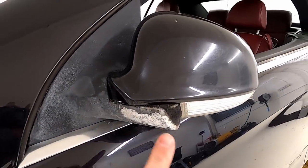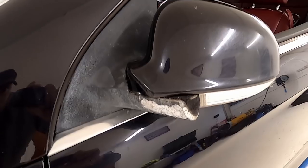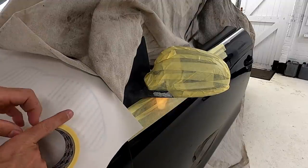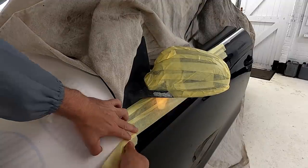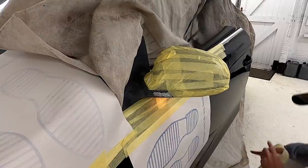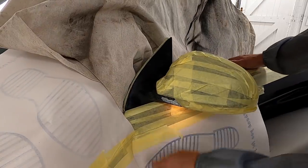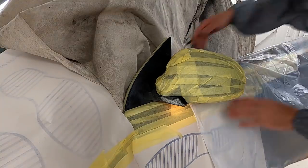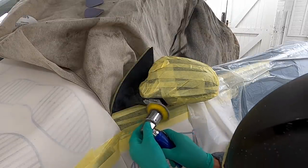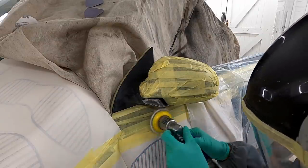Another thing letting the car down was these mirror surrounds - as we can see they get a little bit of light corrosion in them and the paint flakes off. This was a problem for the earlier Eos, I think up to about 2009, and then Volkswagen changed to a different type of mirror surround so they didn't have this problem. I've thrown a big dust sheet over the top of the car and I'm using some floor mats to mask up the area local to it, plus a seat cover over the door. Most of the area has to be done by hand but I'm using a little DA here because I can safely get onto this focal point where most of the corrosion is and just sand that out.